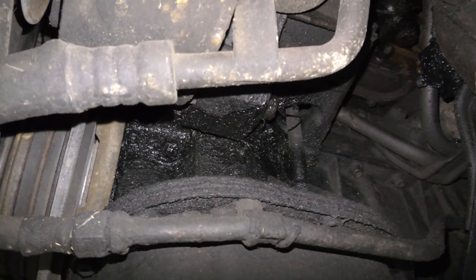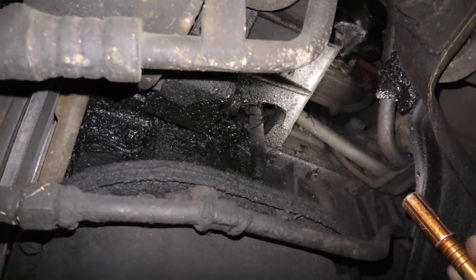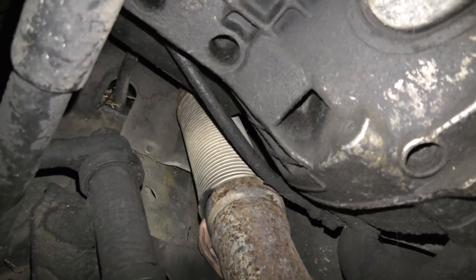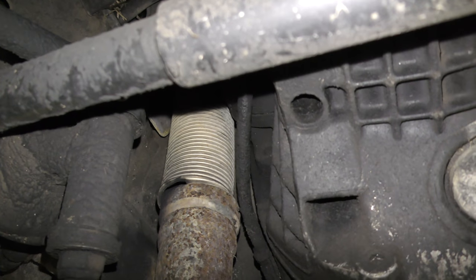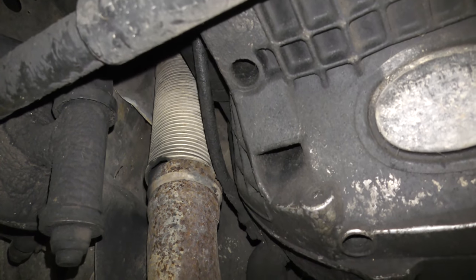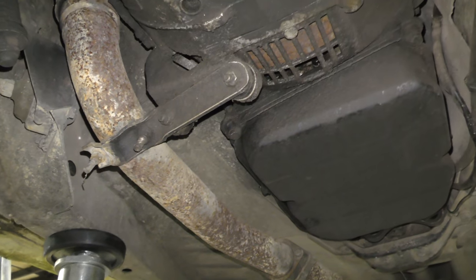There's some sludge on the side of the engine — it very likely could be from the fuel leak as well. Another common issue which I just looked at now and confirmed is broken: the corrugated flex pipe right here. I could fit my finger in this hole. The corrugated tubing on the exhaust is broken. That could probably be welded, or I'll probably just replace the whole down pipe.